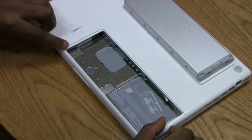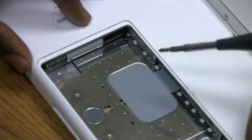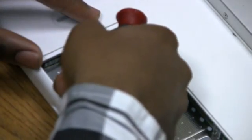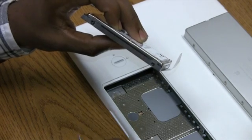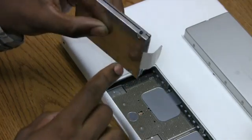Next, keep your eye out for the white tab that's attached to the hard drive. It might be helpful to use the screwdriver once you see the white tab — it helps it come out easier. When you've got the white tab, just pull on the hard drive gently and it comes right out. Once you've got the hard drive in your hands, you'll need to grab the Torx screwdriver in order to remove the black screws from the aluminum chassis.